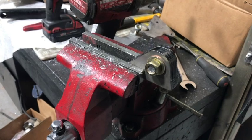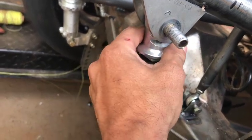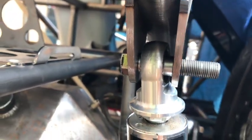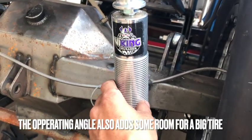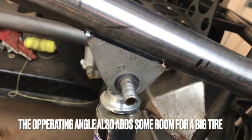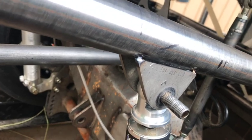As you can see, by clearing this out we got the full distance of the washer — full integrity of the shock bracket material. We could have taken a little more material off the top since we have about a half inch of clearance, but it's just not needed. These shocks are operating at a slight angle, less than five degrees, so the spring rate percentage is slightly offset but nothing noticeable — we're not pro stock racers here. We're going to put a brace back here and probably a brace on the front to add a little integrity.